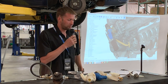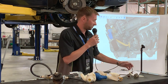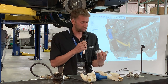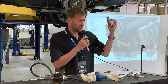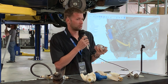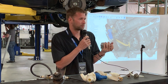And then how it all turned out, awesome in my humble opinion. I'm probably the most biased of anyone here, so, grain of salt, I suppose. But I'm really, really happy with it. Looking at flow area, the actual area that's in there, it has about 8% more than the stock setup, because the stock thermostat neck is actually fairly small on the interior, because the cast wall is very thick. So the machined billet we have here is thin, still plenty strong, of course.